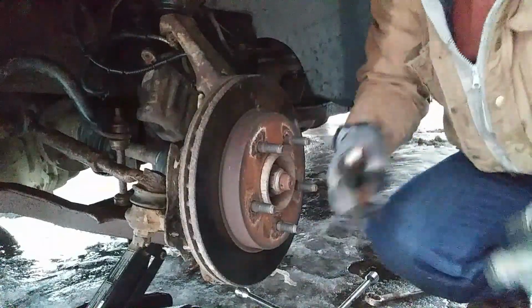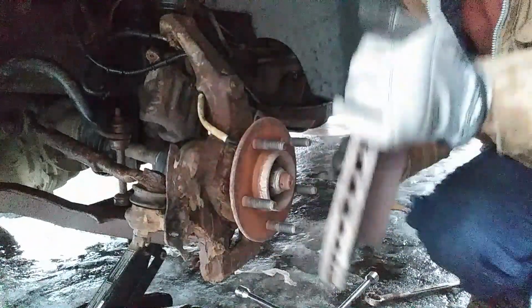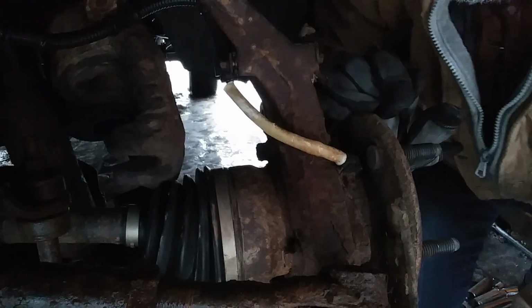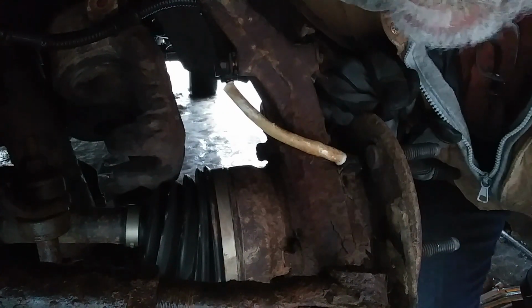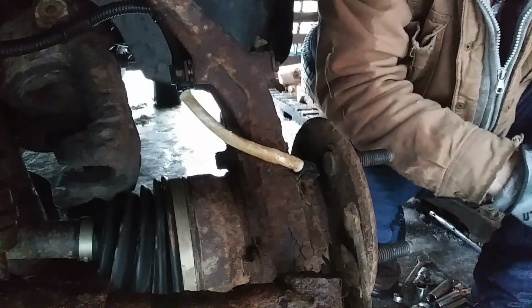Brake assembly. Brake mount off. Rotor. This is your hub assembly here. Now I don't know if I can get you in there to see or not, but behind here, right there, there's a bolt, and then there's one more over here and one more down here. So there's three bolts that hold that hub assembly on. So what we want to do is find out what size they are